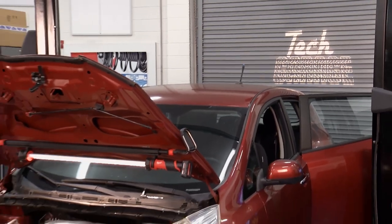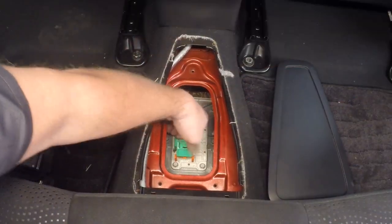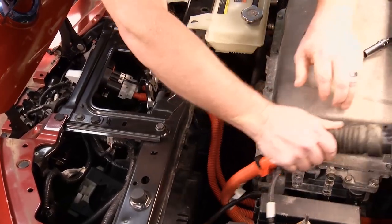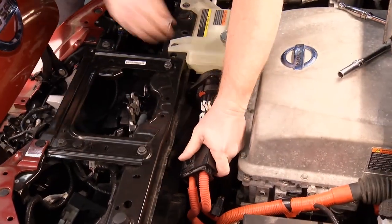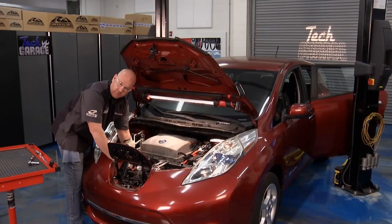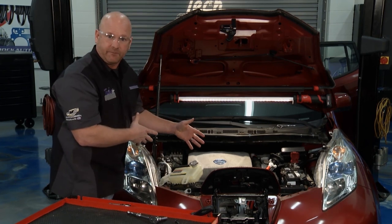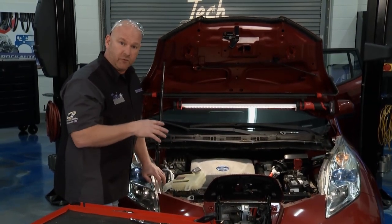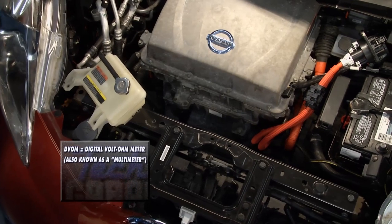One final mounting bolt in the top of the old cooling fan — but before we got to this, we pulled that master disconnect switch inside. Not hard to get to: three 10-millimeter bolts, a cover, pull the switch. We let more than a half hour go by so all of the energy has dissipated. Then came up to the front and pulled the charging harnesses back. Again, just a couple bolts in here. Nissan's made this access very easy — pulled them back out of the way so no way they can get in the way of the project. This goes back to John's trip to the Nissan dealer — they scanned the code, then did a final output test of the fan to see if it was, in fact, working or not. It was not. We couldn't even do that test with a DVOM right here in the garage — that's how proprietary all of that circuitry is.